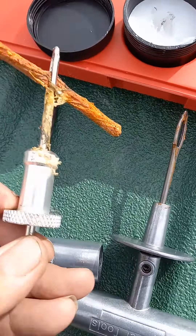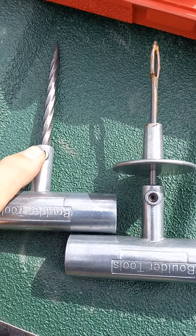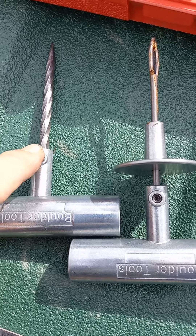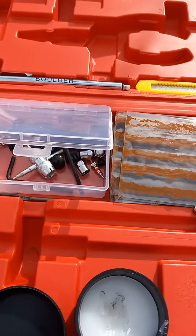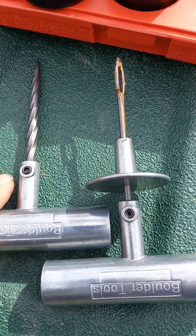If you've got bigger tires, I really like this kit. One thing to note: the valve core heads were not tightened. They include the little tool right there to tighten these down — mine were loose and actually came out in the tire, which was really alarming.